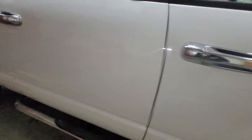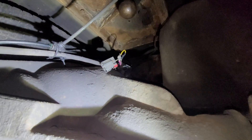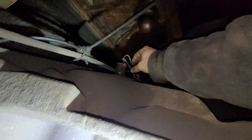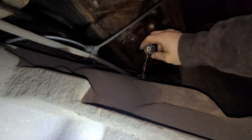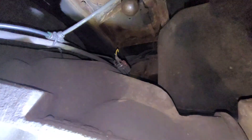Now that the ABS sensor on the front right/left is taken care of, the light did not go off. So I came back here and did some digging. I remember seeing some glue on that, and I didn't pull very hard at all — and that just came out like that. The wire literally just ripped right there. Somebody attempted to glue it at one point.